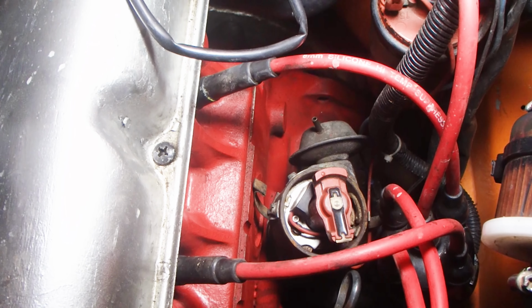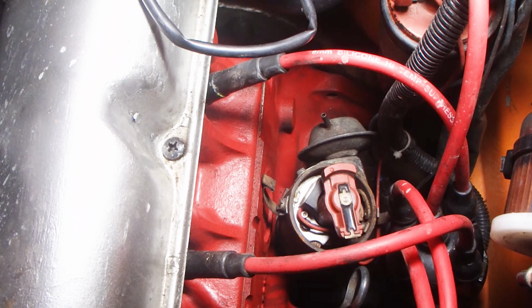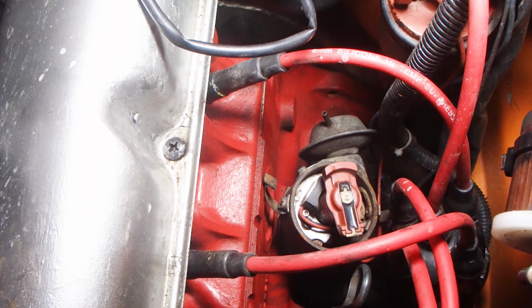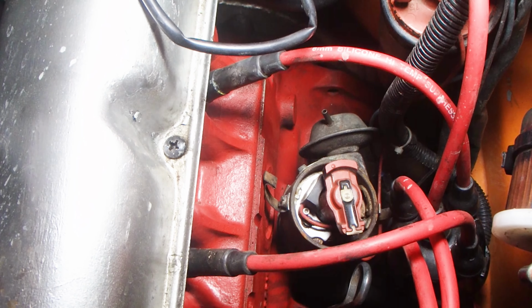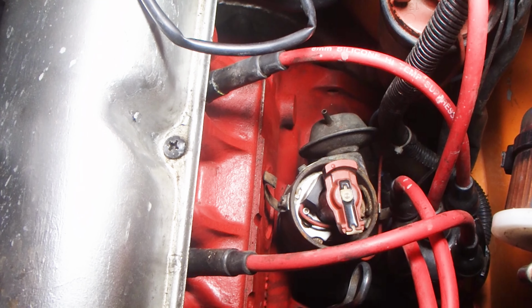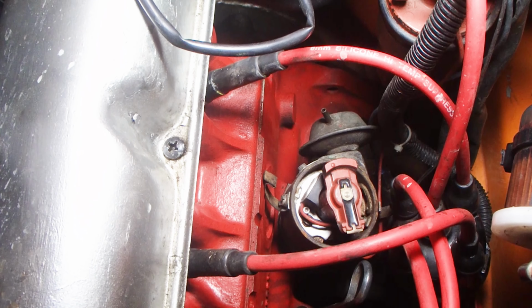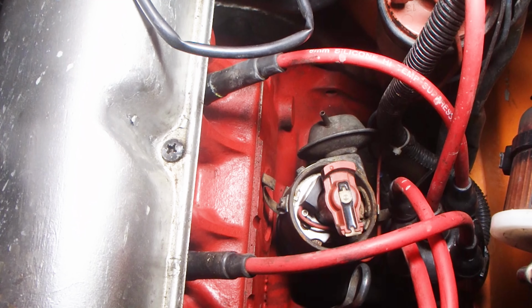the spark happening in the cylinder a little bit later, reducing pre-ignition, which is where the fuel ignites a little bit too quickly, and that results in problems like you can burn pistons, and it results in a pinging noise, which is really bad for the engine, damages it really quickly. It's a really tough engine, so you can do it a little bit without damaging anything, but I really need to fix it on my car because it's doing it too much.